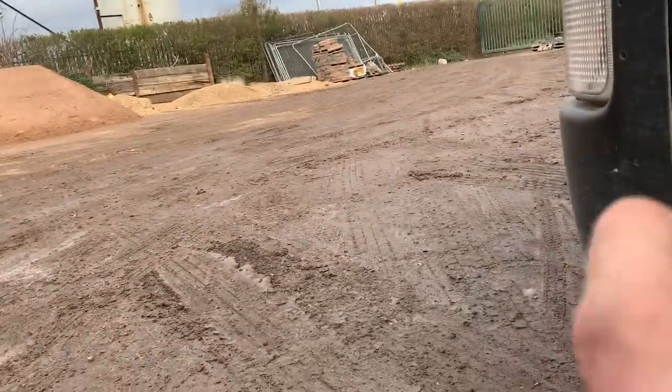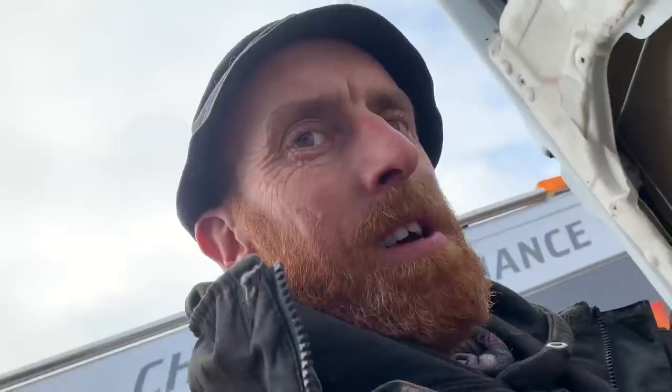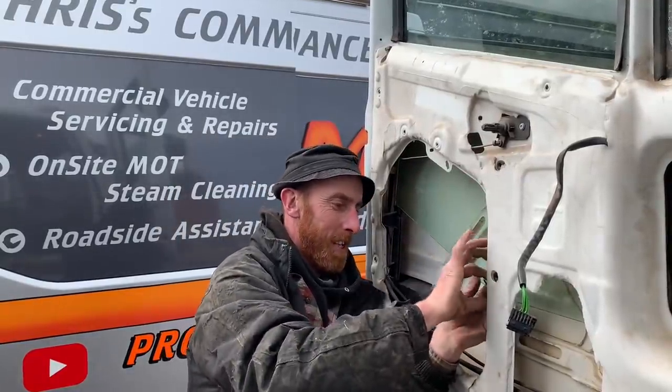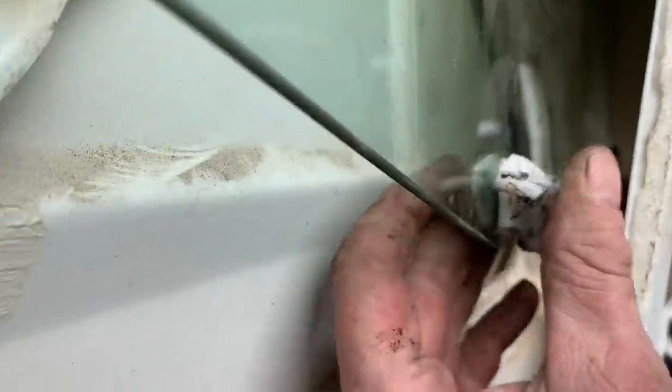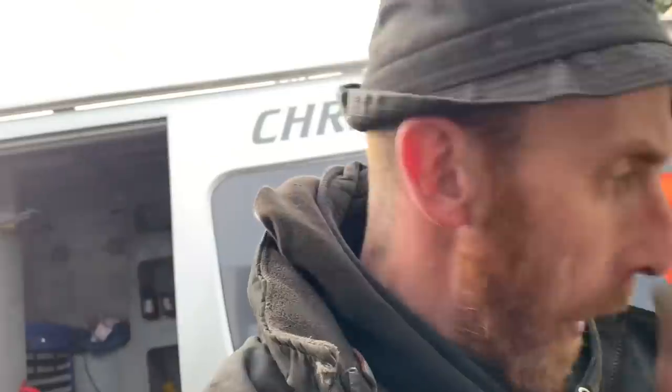By rights it should work. I haven't got a clip - it's meant to have a clip there where the window goes. You're meant to have an R-clip or something through here, and that must be sold separately. Unless the old one's in the actual door panel. I remember this bodge - I had to put a self-tapper through it because that clip broke. It lasted a good six months to a year, that bodge.